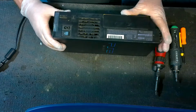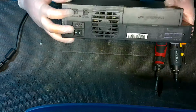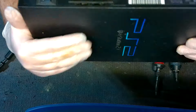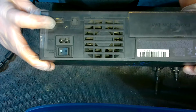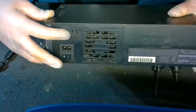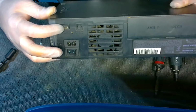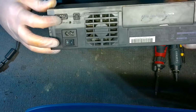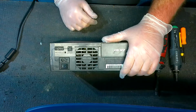So what we're going to do now, bear with me because this is going to be really difficult to show on camera. Not only is it small in there, but it's also really dark, so it's just hard to tell. So this is the top of the console right here, and this is the bottom. What we've got is on the top side, inside the port, you'll see that it's got a metal lining that goes around the inside, and then a layer of plastic that goes around the outside of that. That metal layer on the inside, on the top, which is on this side, there are what I call pressure clamps. These pressure clamps get worn down really easy, and that's what we're going to be fixing with this pin.